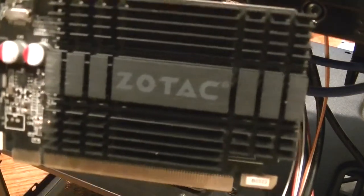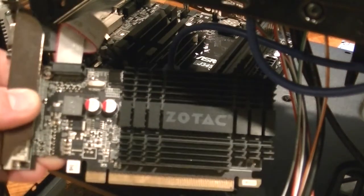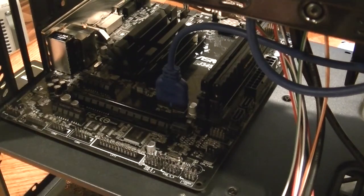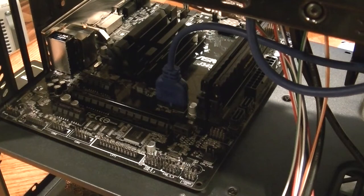The next thing is the discrete graphics card — a Zotac GT710. I really like the Zotac brand; it just oozes quality. They have it in a full X16 connector style, as this one is, and also in an X1 connector style — useful if you only have X1 slots available, since ASRock does have several models with only X1 slots. Because this is a low-power graphics card, it will only need an X1 slot, and that's still plenty of bandwidth. I like the Nvidia chipset on the GT710 because it does just a little more than the onboard graphics and handles things like overscanning correction on TV.